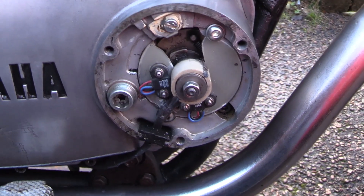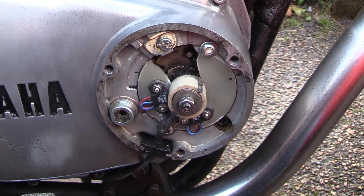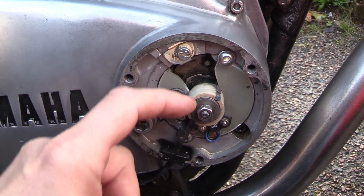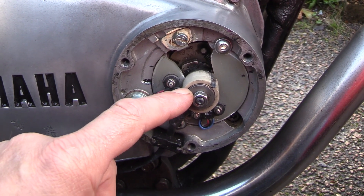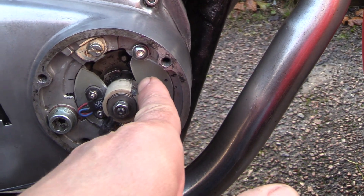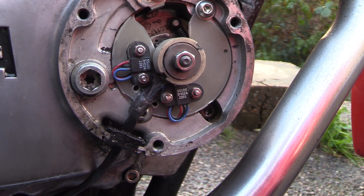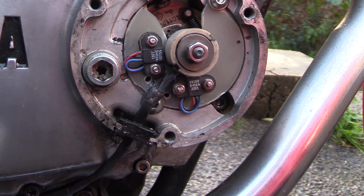Here's the little module I fitted — this is where the points would have been before. It's still using the old mechanical advance system, so it relies on centrifugal advance — it's not electronic advance. So if you buy one of these modules, you've got fixed electronic triggering but you'll still use the mechanical advance. What I've done is get a piece of PEEK — a high-temperature plastic — milled a slot in it, and put a powerful magnet mounted there. It has to be the south pole facing outwards; if you use the north pole, the Hall effect sensors won't work. There are two Hall effect sensors mounted here. As it's a 180-degree crank, they have to be firing at 90 degrees to each other because the power strokes are not evenly spaced.